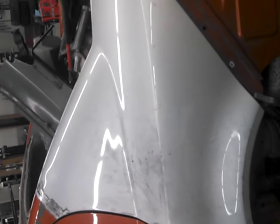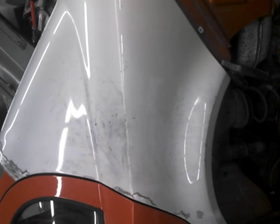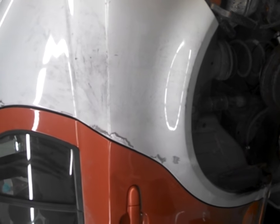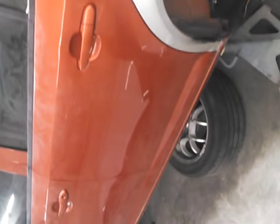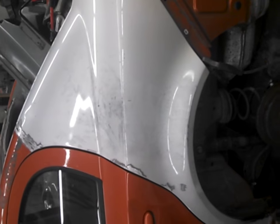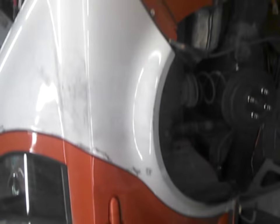After that we'll sand down the silver panel with 600 grit. I know some say you can get away with 400, but I go to 600 and sometimes 800, then paint over it. I'm still using catalyzed paint — not into waterborne yet. When we get waterborne in our shop I will show you how to do that.